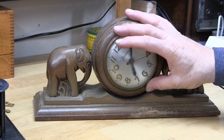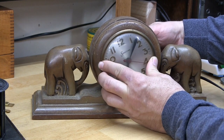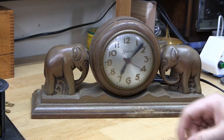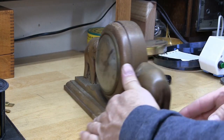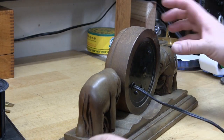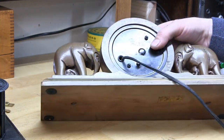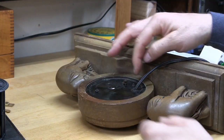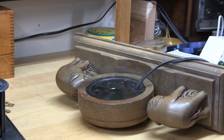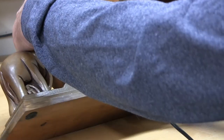The first thing you notice is the dial is pretty wonky here — it's supposed to be straight up and down. These are electric clocks, they're held on from the back, so when you loosen the screws in the back the front's gonna fall out, so you're gonna have to lay this down. There's just two screws — actually pretty simple. In fact, these screws are already loose. The setting knob usually does not fit through the hole, but this one looks like it will. We'll just take these two nuts off.